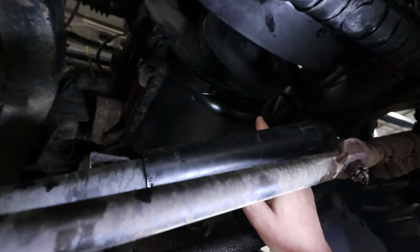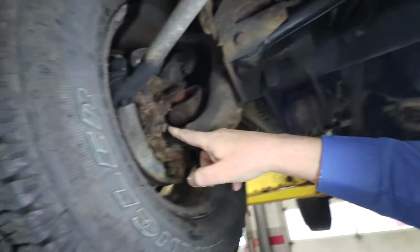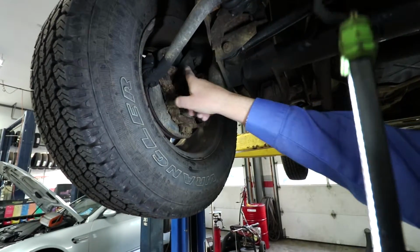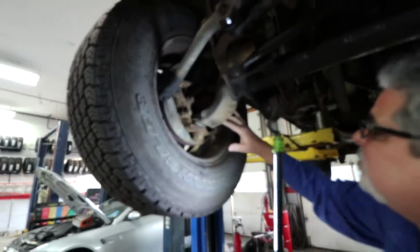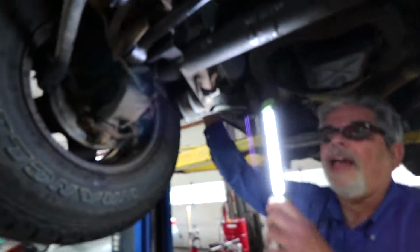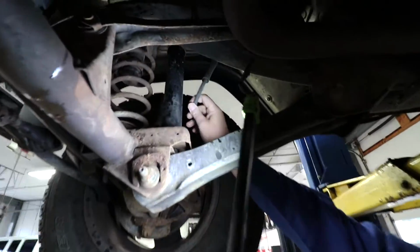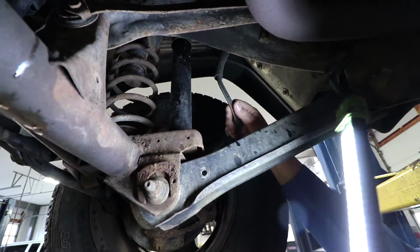Why is that happening? I'm also going to look at things like damage caused by rust. This car's got a little rust under it, and the U-joints have a lot of rust coming out of them. This is a car I want to be concerned about, because this should be taken care of. We're going to look at the brake lines. The brake lines are right here. We're looking at these rubber brake lines to make sure they're in good physical shape. They look great on this car.